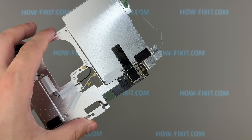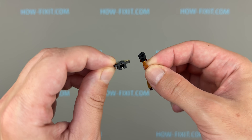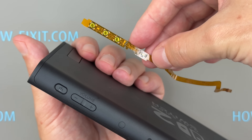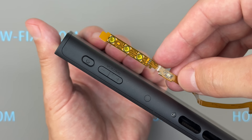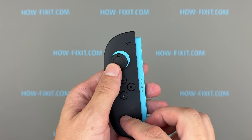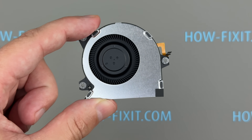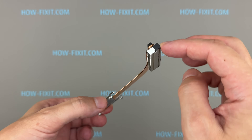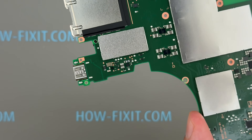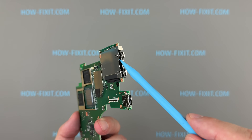Let's summarize. The microSD slot is modular and easily replaceable, requiring minimal effort and no complex repair process. The headphone jack and top microphone are also modular, making them simple to replace if needed. The Joy-Con connector can be replaced without soldering, and the process is quick and straightforward. The power and volume buttons are mounted on a flexible cable that can be easily swapped out by just opening the console case. All components of the Joy-Con are modular, including the analog stick — a commonly worn-out part — which remains user-replaceable in just a few minutes. The Switch 2 now features enclosed speakers, which significantly improve sound quality and volume. The cooling system includes a relatively powerful fan; however, the heat pipe is extremely thin and requires careful handling to maintain its thermal efficiency. The Switch 2 now includes two USB-C ports, and while this is a welcome upgrade, replacing these ports requires some soldering skills. Notable disadvantages include the game cartridge slot being soldered directly to the main board, making replacement difficult and requiring advanced soldering expertise.